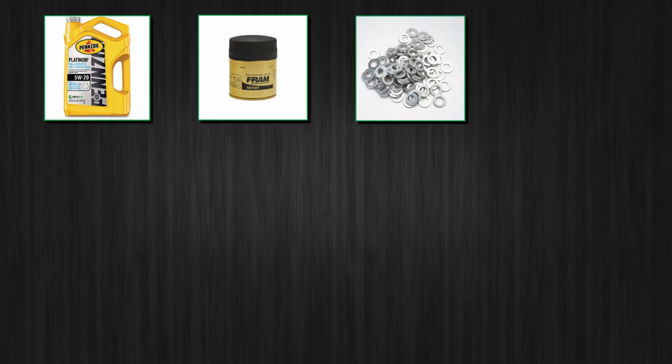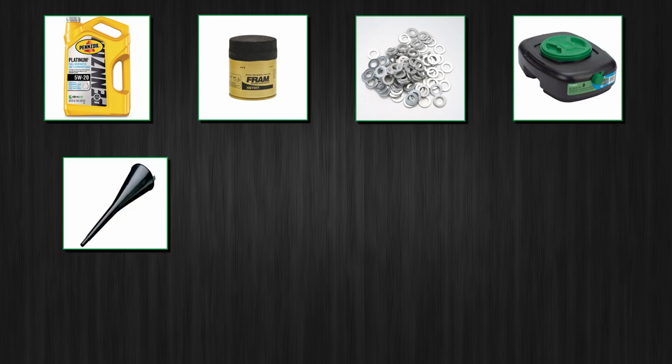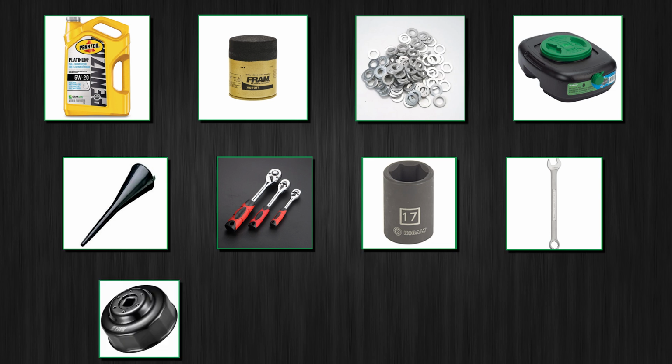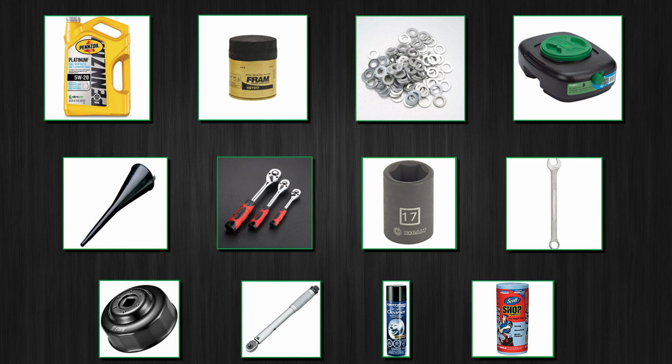Here's a list of tools you need to complete this job. 5W-20 motor oil, new oil filter, new drain bolt crush washers, drain tub, clean funnel, various ratchets, 17mm socket and wrench, oil filter wrench to break the filter loose, torque wrench if you want to properly torque your fasteners, brake cleaner, paper towels. Affiliate links to everything I've used or recommend are in the description. Alright, let's get to it.